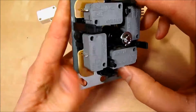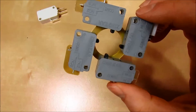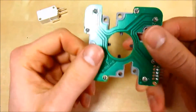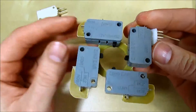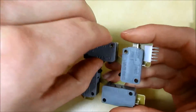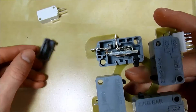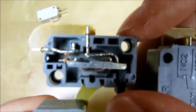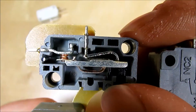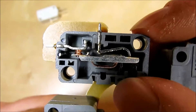This joystick breaks down to a few components. The micro switches are all permanently soldered to a PCB that has the connection breakout. You can pop off one shell of any micro switch and carefully analyze the action to make sure it's working. If it's not working, a few of the internal components can be swapped out and replaced.